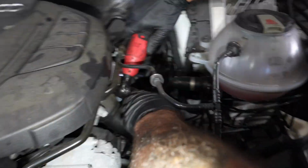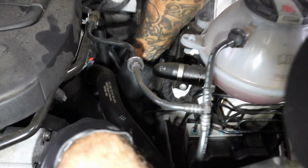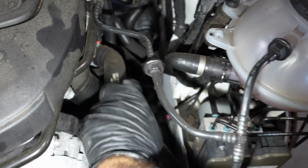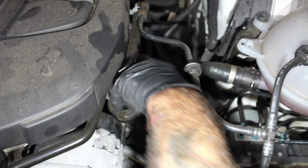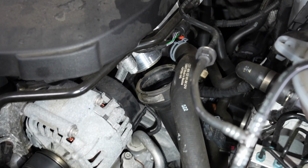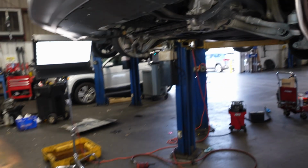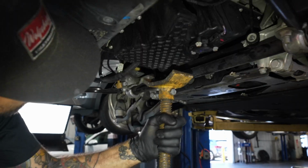Okay, let's go over to the throttle body. Another 7 mil. Disconnect the charge pressure sensor. Slide the locking tab back, and then push down on the remaining tab. Down. Take this out just so we can actually see the MAP. Yep. A little bit more room coming down. All right.